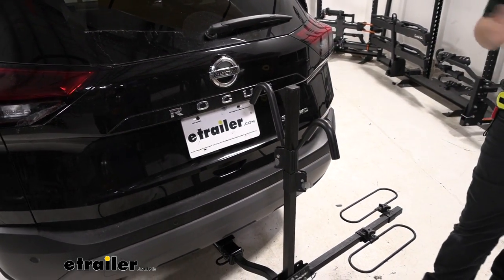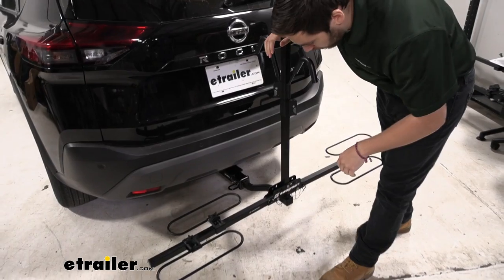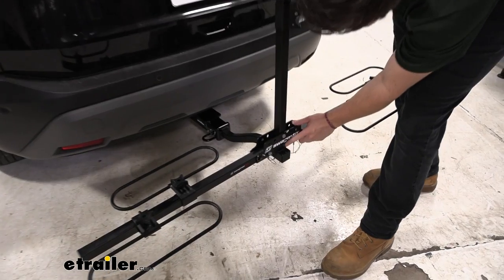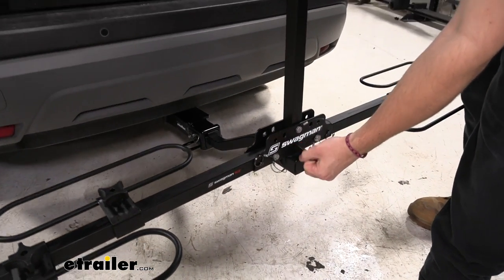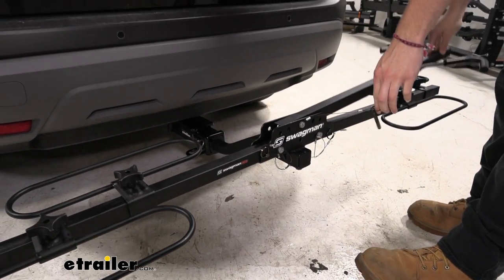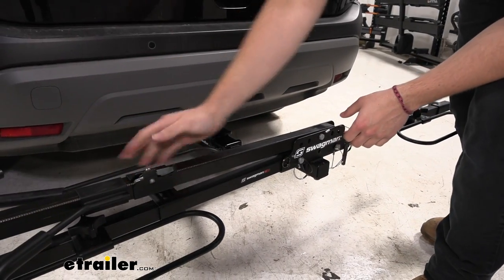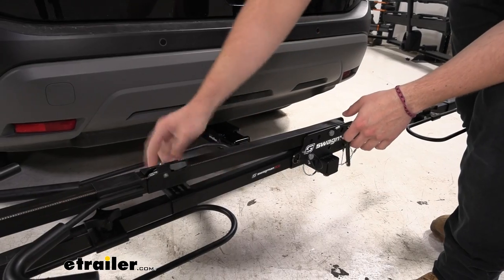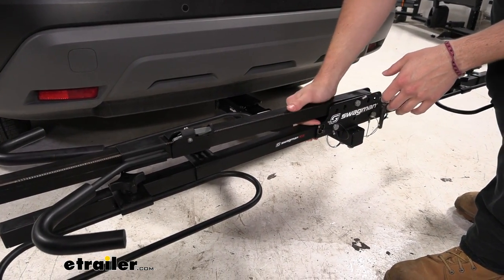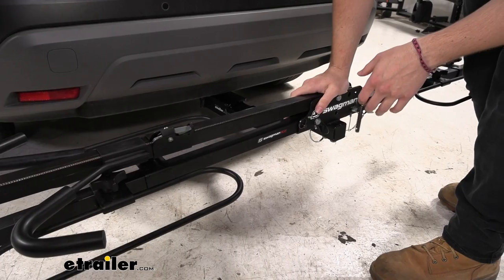With this rack, we still want to be able to access that cargo in the back of our Rogue, and we actually do have a way of doing so. You'll see these little pins throughout the bottom assembly here. Our middle one — we just want to pull that right out. That's going to release our center mast and we can go to either side and actually drop this down to get it out of the way. You'll notice it will start interacting with these knobs, so if you had your cradle set a little bit further, you're going to have a little bit harder time getting that down. Shifting those cradles to the side can make that dismount a little easier.